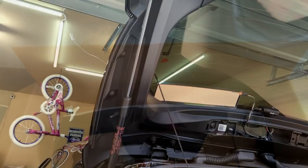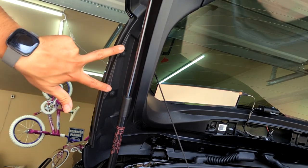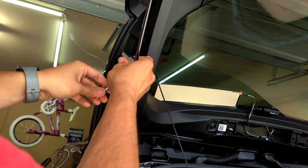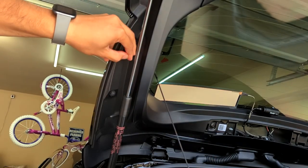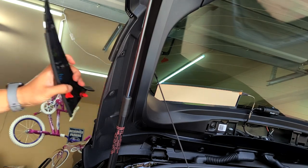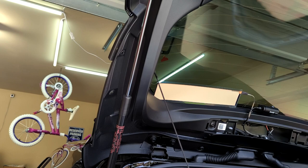Let's start off in the trunk. The first two parts are going to be very easy. You're going to take an eight millimeter wrench or socket and take off the factory stanchions — they're not on very tight at all because they're eight millimeter bolts. The GR Corolla trunk is completely made of plastic; there are absolutely no metal parts in the trunk lid itself. Once you have those two eight millimeter bolts out, pop the factory stanchion out and put the bolts back in temporarily, because you will not need to reuse them — they supply you with longer ten millimeter bolts.